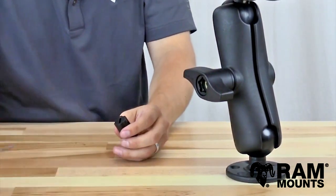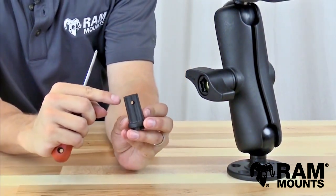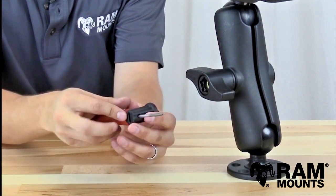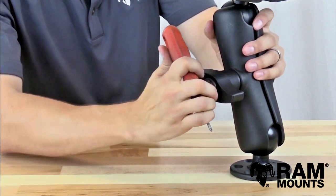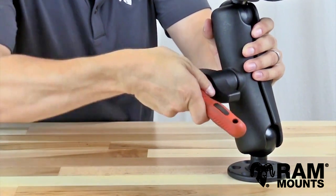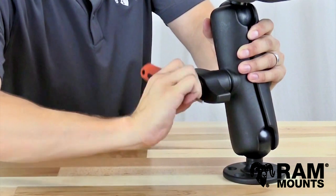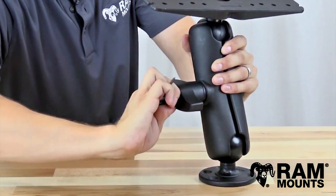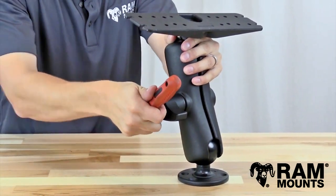At that point, you're going to take the thin screwdriver. You'll see that the key has a hole in the middle. With that hole, you're going to insert the screwdriver inside of the hole, and the screwdriver is going to give you additional leverage when tightening that security nut in place. So then you line up the pinlock pattern and continue tightening. It takes about a minute or so to get it all the way through. Once you have it in there, the jammed threads will start getting a little more easy when tightening, and then you'll feel it fully lock up.